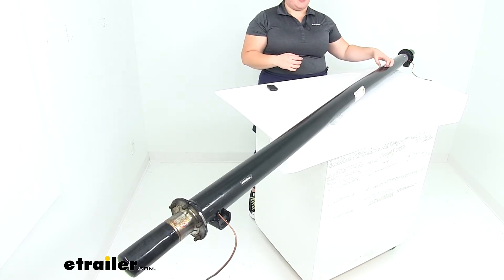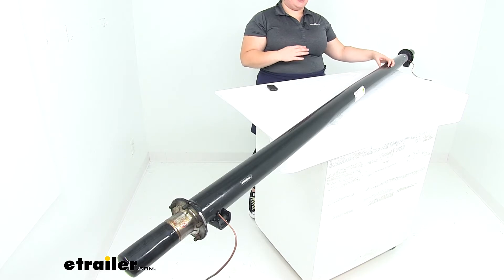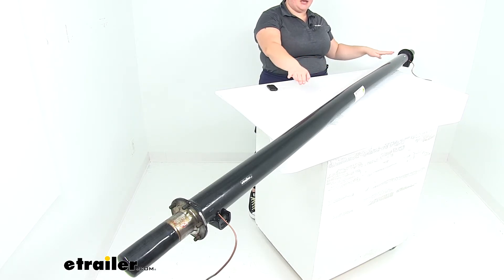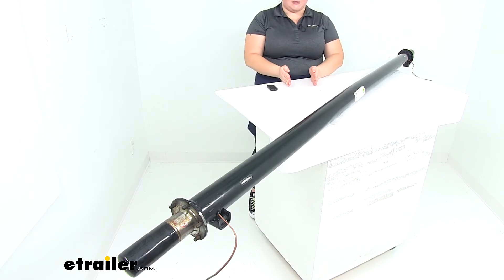This is going to have a high steel construction. You might notice that there's a little bit of a bend in that beam. That's to help give us a zero camber, which basically means there's no tilt in or out for our wheels. It's going to give us straight line acceleration and also helps our tires to wear evenly all the way across the width of the tire.